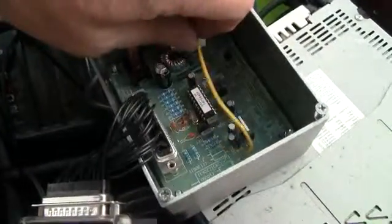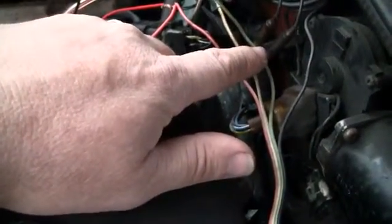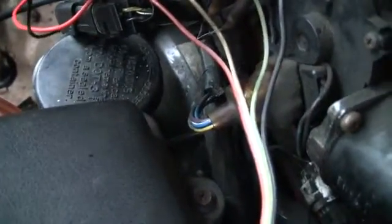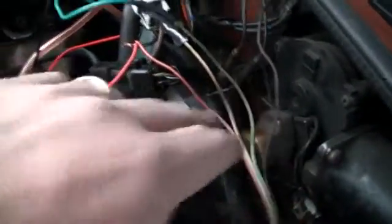I don't know what the ignition box draws for current. That's gotta be grounded - that's the ground. This thing's got red, which is the power; white, which ends up being power for the coil - I don't know if that's gonna be 300 volts; the black which I didn't hook up yet - I gotta put the resistors in series with it - to this brown wire here. That might just be an SCR trigger. And green, which is the signal in, which triggers that noise - that would go to your points. So this should work nice.